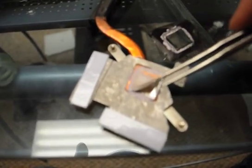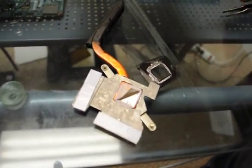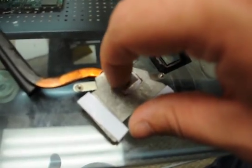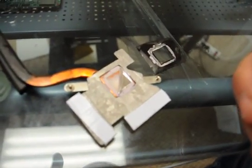As I was stating, that's exactly what's underneath it here. You have the thermal compound right here, and that's the aluminum. What you have to do is just pull that aluminum off and clean that out, and it should be good to go. That's just an example to show you what it looks like and how it's all dried up and hard — you've got to dig it off with something to clean it out. That's what's going to happen if you don't clean it.